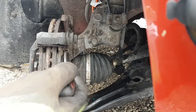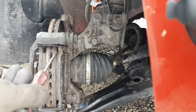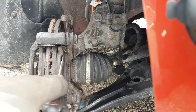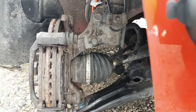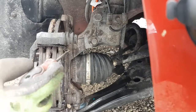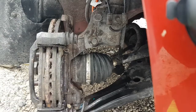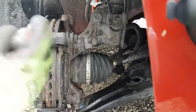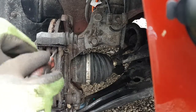Basically what happens is when your brakes get to a certain point, as you can see, this one's almost touching. You can't really see it, but there's still a little bit of a gap there. So I've got maybe 15% brakes left, 15, maybe 20. But once this pad wears out and that squealer starts touching, it makes a ton of noise, like a brrr as you drive. The whole point of this is you want this squealer tab on the leading edge of the rotor, so the rotor would spin this way as you're driving the car. So you want that tab towards where the rotor would normally turn against, right? As you drive forward, the rotor spins this way and basically pushes this tab down into itself.